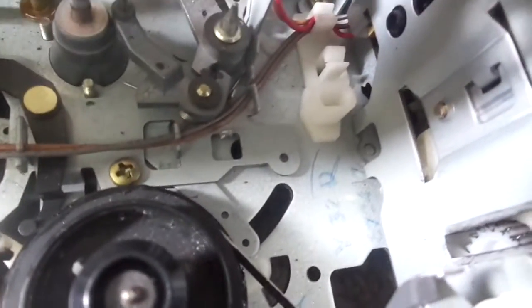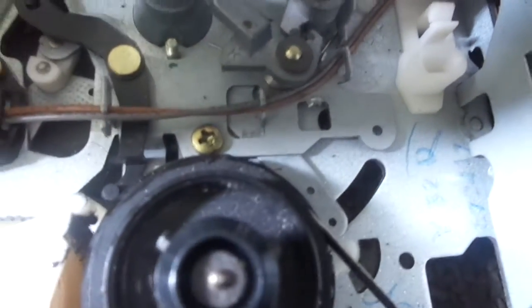There was also a major belt problem over here too — the capstan counter belt. Only on old VCRs, not all of them, but some of them. It was really gooey; you can see it on the top — I tried to clean that, it's disgusting. So I replaced it with a rubber band since there was gooey substance on it, and it might just work fine now.